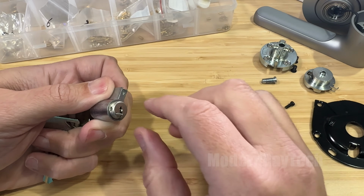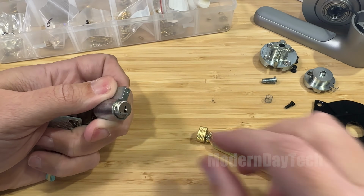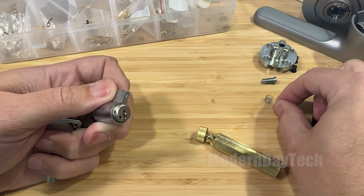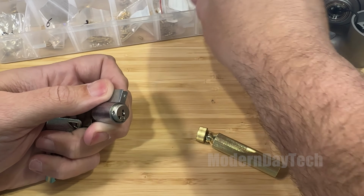And once you unscrew the end cap, the whole tail will come off with it. Be careful, the pin that you were pushing down has a spring underneath. You want to take that pin out and probably the spring also, so you don't lose it. If you drop it on the floor and the carpet, it's just going to be a bad day for you. So make sure you put that on the side and you can reinstall that later.